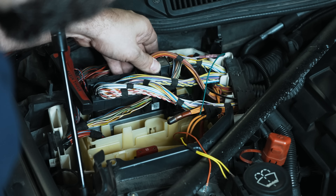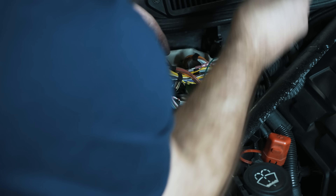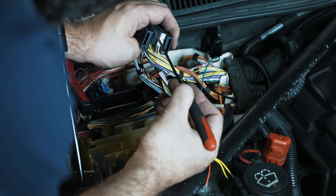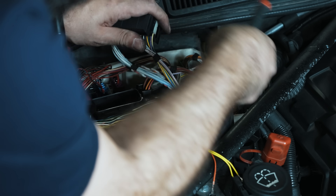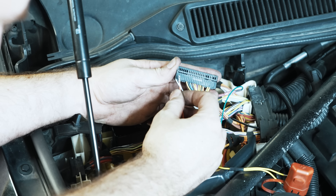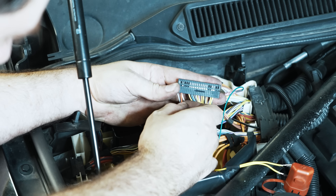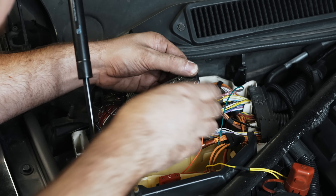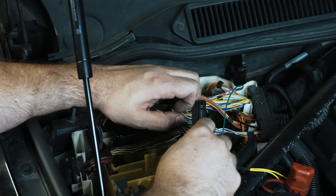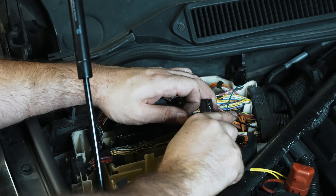Reinsert until it clicks and put it back on the ECU — push in on the connector while pushing down. It turns out on this side I could have left that piece in place — that's an FYI. On the big connector, look for the arrow side showing pins 23 to 46. The orange wire goes into pin 25 — two over from the white and blue wire: 23, 24, 25 — into a vacant pin. Flip to the opposite side, labeled 1 to 22, and extract pin 10 — the yellow wire — by pushing on the pin.